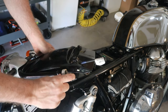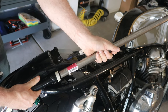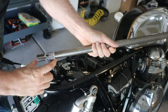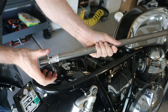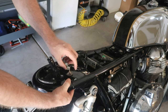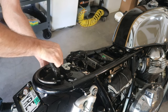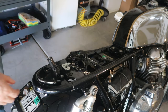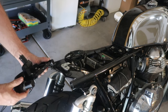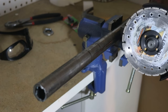I looked for couplings that would fit, I couldn't really find anything. So what I did — I have this one inch pipe that I'm going to cut to be able to slide in. But obviously, a one inch pipe can't go into a one inch pipe. So my idea is to cut this pipe to the size I need and then put a slit in it. Hopefully the slit will allow me to compress it just a bit to be able to slide in and out and keep a nice tight fit. Right now you can see I have it already set up with just these wing nuts — it only takes a few seconds to unscrew and then be able to slide this whole tail right off. Let's cut this thing up and see if we can make a coupling.